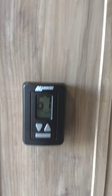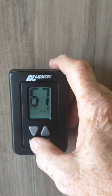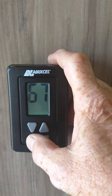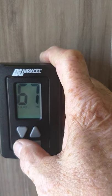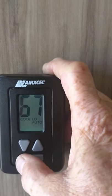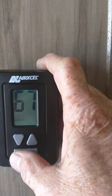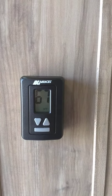This is your thermostat. Hit the mode button once to light it up — we're on cool auto. Always try to run it on auto when you can. You cycle through heat, off, fan auto, fan low and high, cool low and high, and auto. Fan is just the air conditioner running without the compressor; cool is the full air conditioner; heat is the furnace. There's a lag time of up to five seconds or more after you change a setting before it responds, so be aware of that.